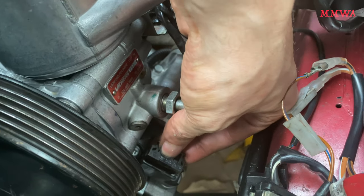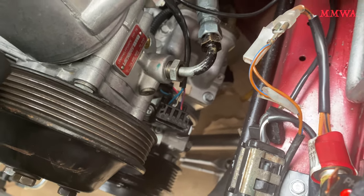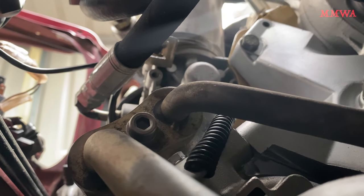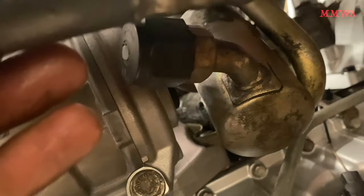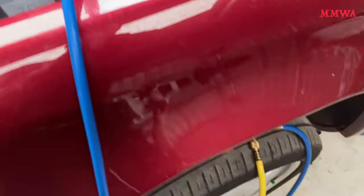I can now connect the compressor harness. This is what the manifold looks like at the rear — as you can see on this car there's plenty of room to access it. That's the model of compressor if you're interested; it is not an aftermarket one, it's actually the OE — a perfect fit. I have caps on here just to stop anything getting into the system while it's open. And that's the last hose connection done, with a new O-ring of course.